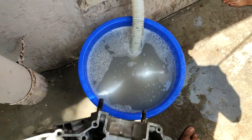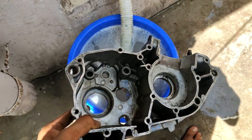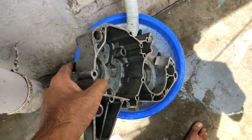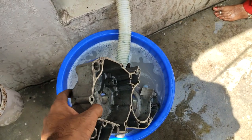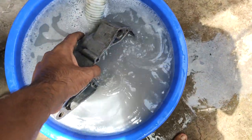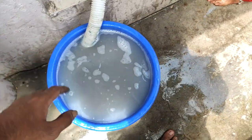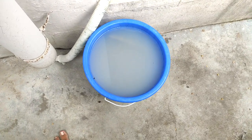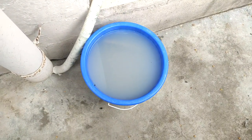The surf water has been filled to the brim and I'll submerge the engine casing fully inside the bucket. Surf is an excellent degreaser — the grease I can't see during cleaning will simply come loose. I have a semi-automatic washing machine, so I'm reusing the wash water to save water. The case will sit there for an hour or two. This is actually the next day — I immersed the crankcase for a long time because I forgot about it. Let's take it out now and rinse it off.